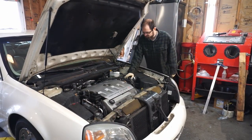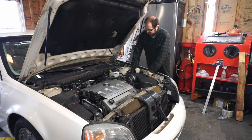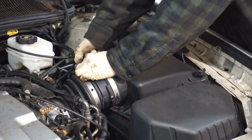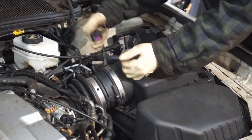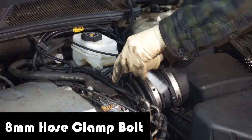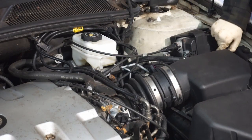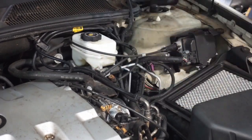The next step is to remove the intake, the air filter and the plenum assembly here — just get that out of the way. This is the mass airflow sensor connection; there's a little squeeze tab, you push here and just pop it out. This is just an 8mm on this hose clamp. Pull up the back and grip it a little and there it goes.